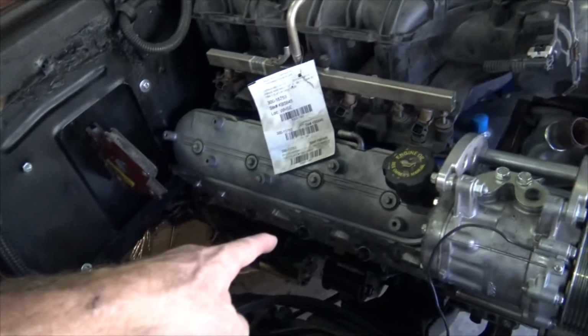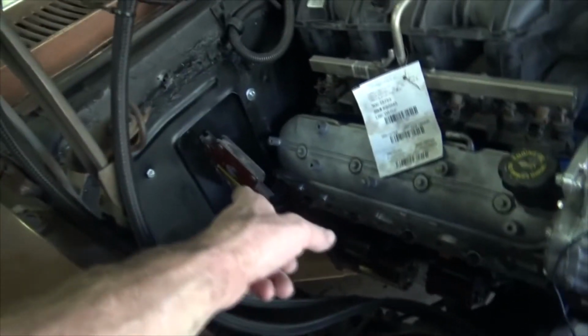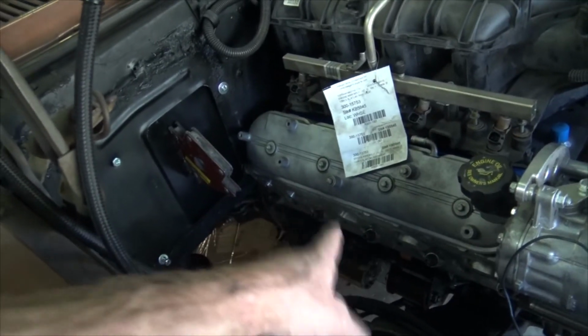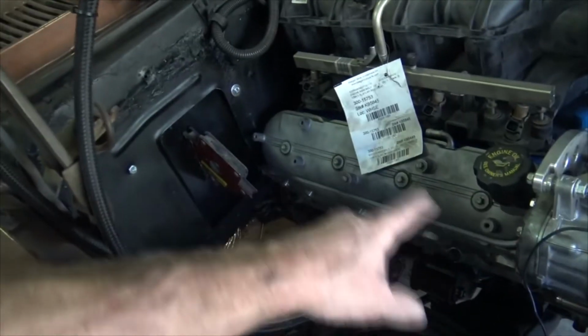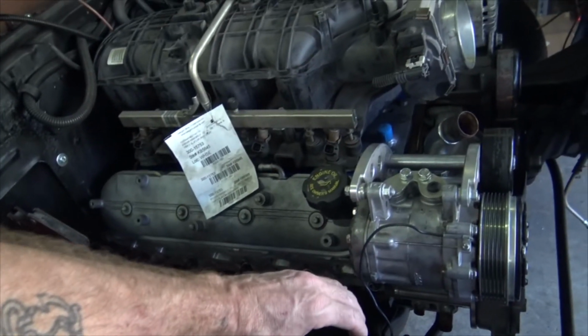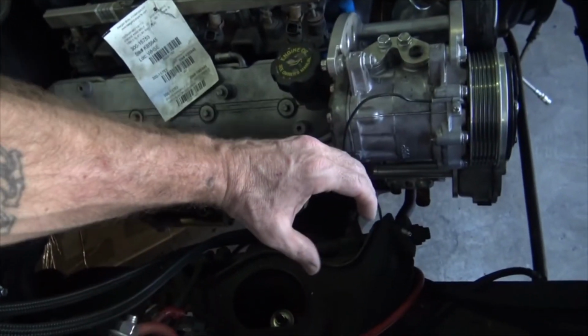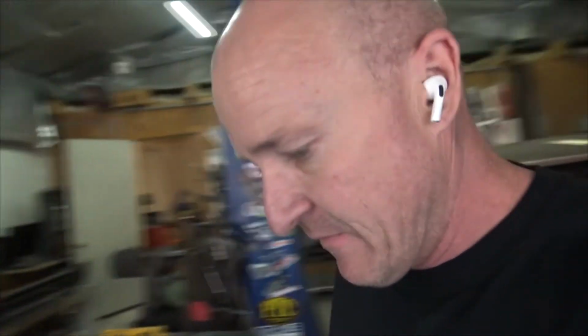But getting this big box out of the way freed up a ton of room over here for us to do that. So what we'll have to do is make a manifold that goes on this side, fits our plugs and everything, and clears everything. So we'll put the coils, the plugs, and the wires on this side, and then we'll build our manifold around that, so it will just kind of come up. That will go down under like we had before, up to this. This will run like this. We'll probably shoot this guy off right around maybe here, I'm guessing, and have it kind of come up to the turbo here-ish is kind of what I am feeling. If it'll work like that, I don't know, but that's the pipe dream.